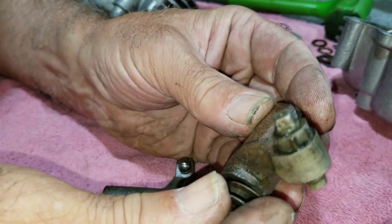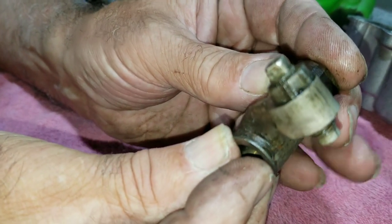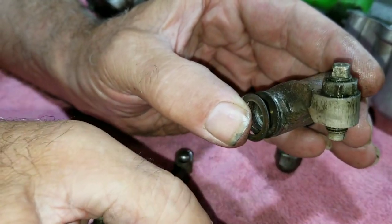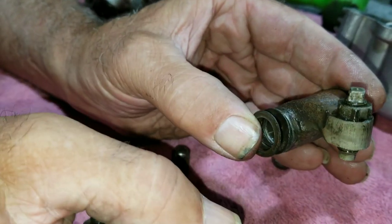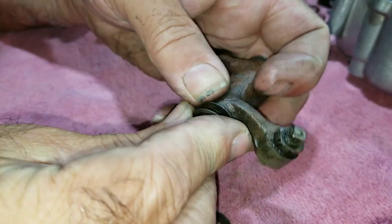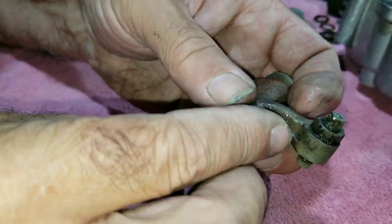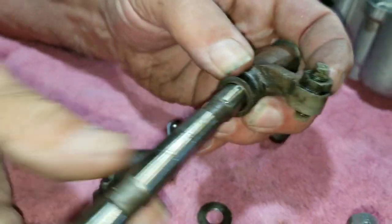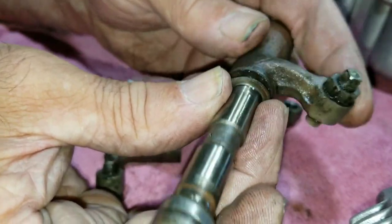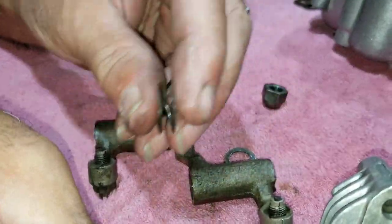The way the book shows it: the washer goes here to create an oil squirting hole, then the factory washer goes up against the rocker box. Some people think the rocker box will wear but it doesn't — it just turns on this washer back and forth, and the factory washer just sits still. There's an oil hole in a spot that allows it to squirt oil out. That's how it should be assembled. And by the way, this one was assembled wrong.